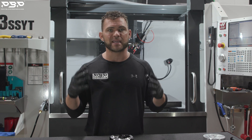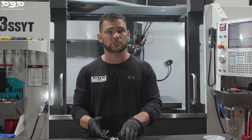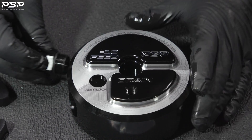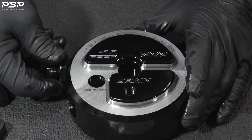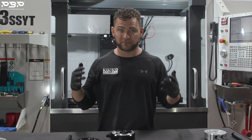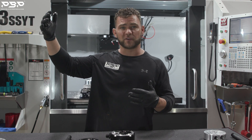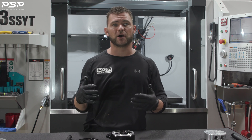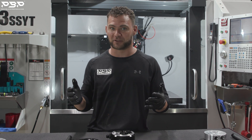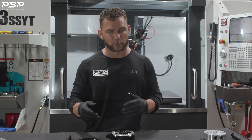Let's lay this guy down and go over the meat and potatoes. Dash 10 — what's that mean? That means this guy is suited for 5/8ths line. We've got a fitting here, dash 10, that screws right in so we can get all the fuel to our fast fuel system. They've got the 220, a 250, and now a 320 gallon-per-hour fast fuel system. We know on the 220s we can fuel them and make 1,000 rwhp.